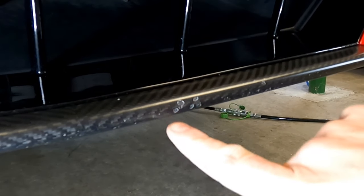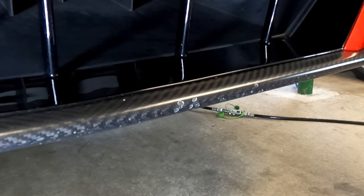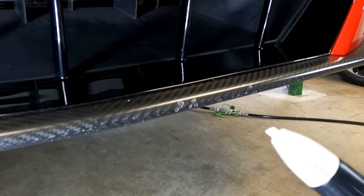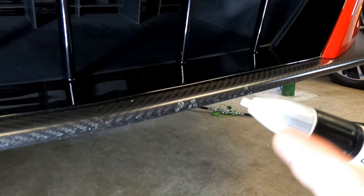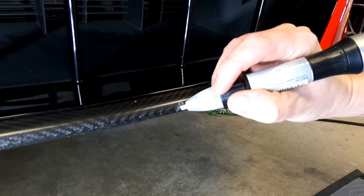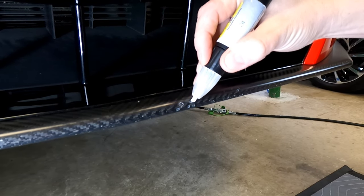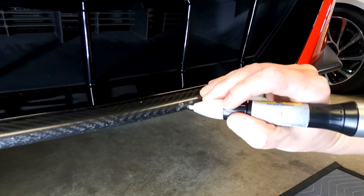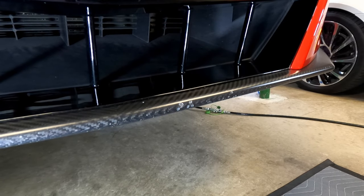What I'm doing is making sure not to stick my knife up under and pry out, because that can actually make it worse. I'm going around the chip and just trying to break it off and send it more inbound to eliminate the white areas. Now that I've used my knife and gotten rid of all the white areas, all we have is holes. The next thing to do is prepare the surface so that the paint can stick. If you get some type of a paint pen, it sometimes comes with a little scratch tip. You can also find these online — I'll have a link in the description below. It's good to just get in here and scratch up the surface underneath so that the new paint has something to stick to.